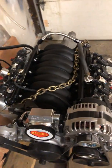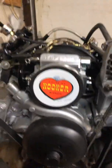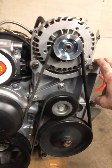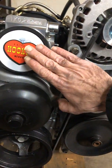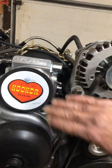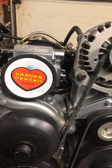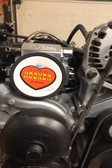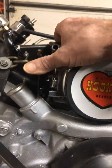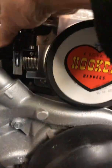So this is where everything starts. I bought this intake and swapped it out from the truck one. When you get to the front of the motor, the first problem I had is I'm using the truck alternator power steering pump bracket — the idler pulley used to be right over here. The original intake manifold inlet was about four inches higher, so there was plenty of clearance. As soon as I put this intake on, the throttle linkage was hitting the water pump housing.